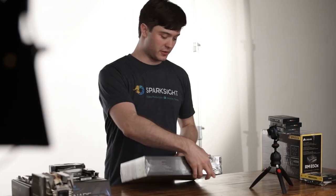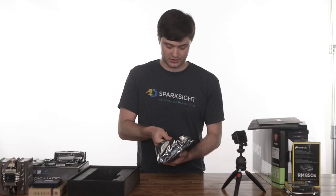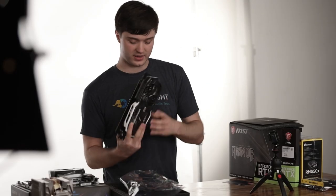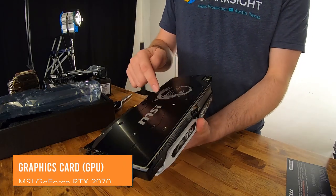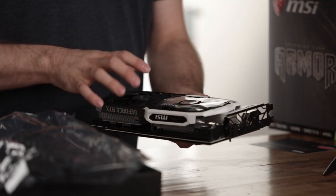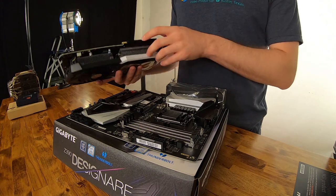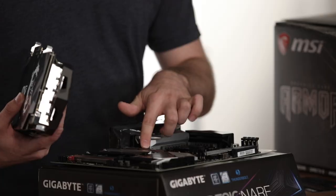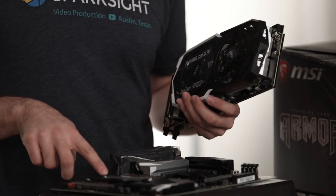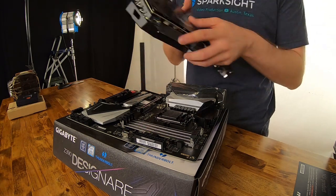If you're building a computer for gaming, this is the one that everyone drools over — this is the graphics card. This is an MSI RTX 2070. The actual GPU itself is located roughly in the middle of the card. It's got its own heat sink pulling the heat away, but you don't have to worry about installing that yourself — it all comes together in one package. The graphics card slots in right here into one of the PCI Express slots. Generally, you're going to want to install it in the one closest to the processor, because that's going to have the highest performance.